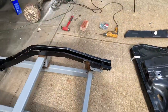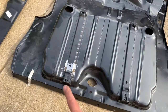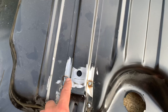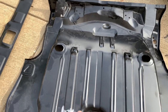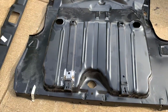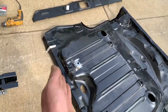Now that we know where this thing goes in relationship to those, I'm going to get it flipped over. You might notice a little bit of cleanup here. What ended up happening is when I test-fitted the tail panel, that side was hanging about three-sixteenths of an inch too far — so when I put the tail panel on, I was actually bulging it out. So instead of drilling all the spot welds out, I only did the first four, took my three-sixteenths of an inch out, slid it back into place, redid the welds, then test-fitted it. So it still fits — I didn't undo the whole thing. That's the purpose of test fitting. There's always probably something wrong. So AMD, you let me down a little bit on that piece, but easy fix. Something to check before you throw it on — make sure it's nice and straight.